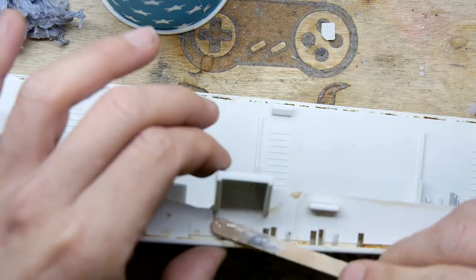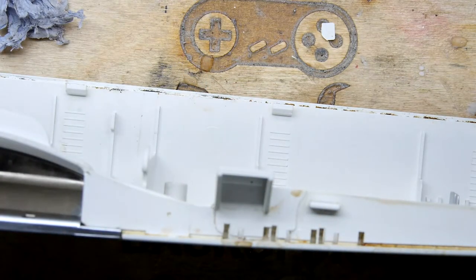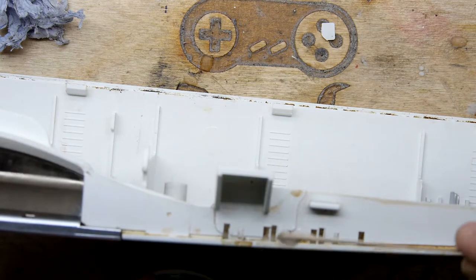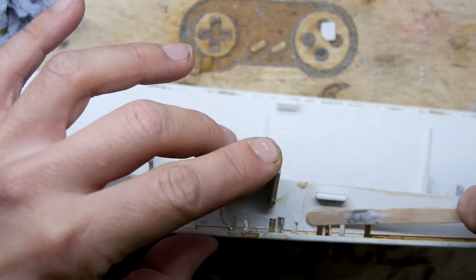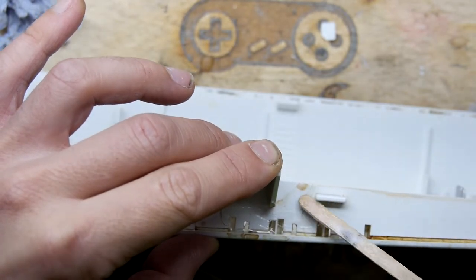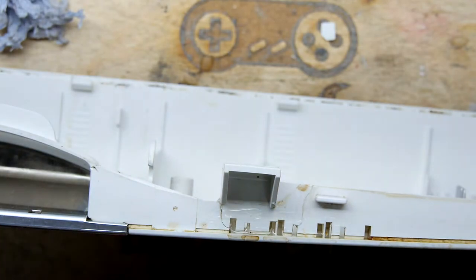So I'm just going to massage some of this resin. This one's got loads of open pores here and there's no mechanism on this side. So I'm definitely going to hit this from the other side when it's all cured up. But while I'm there, I'm buttering it. Why don't I just butter this front face? Let's get plenty. Oh, broke me stick. Plenty in there where we can.